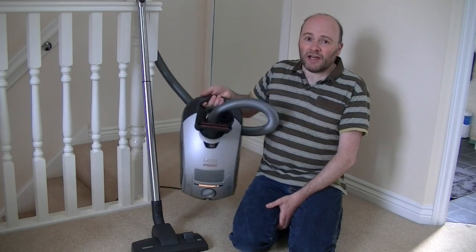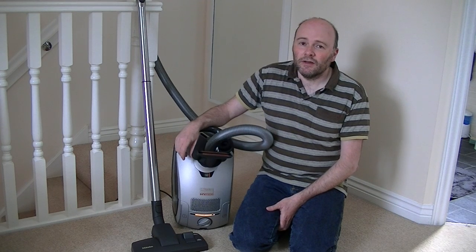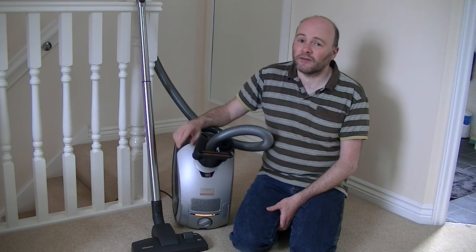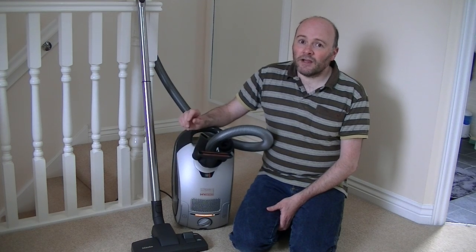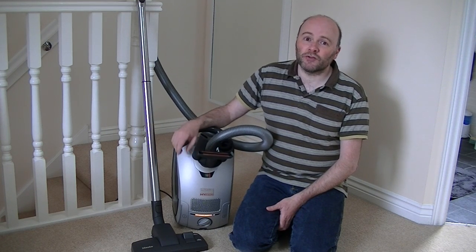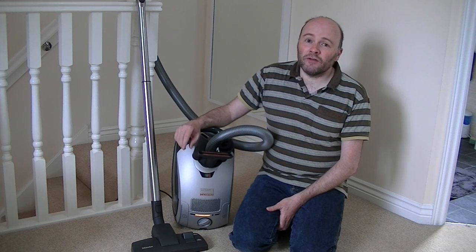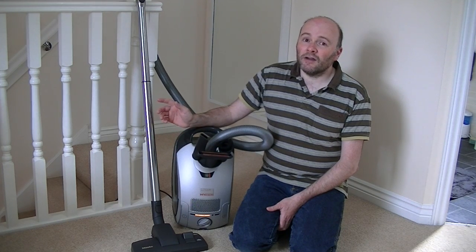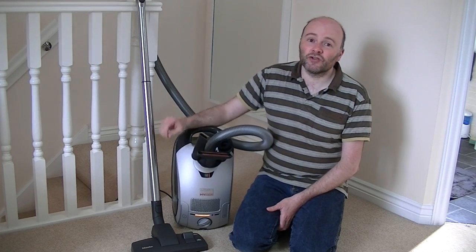This compact but fairly heavyweight cleaner is rather unique in the world of vacuum cleaners because it's a hybrid. It can be used as a conventional mains-operated vacuum cleaner with an 1800-watt motor, functioning just the same as any compact Miele cylinder vacuum. What makes it different is that it has lithium-ion batteries built in, so you can unplug the machine and have up to 20 minutes of use without a cord — useful for areas without a power socket, cleaning your car, or tackling stairs.